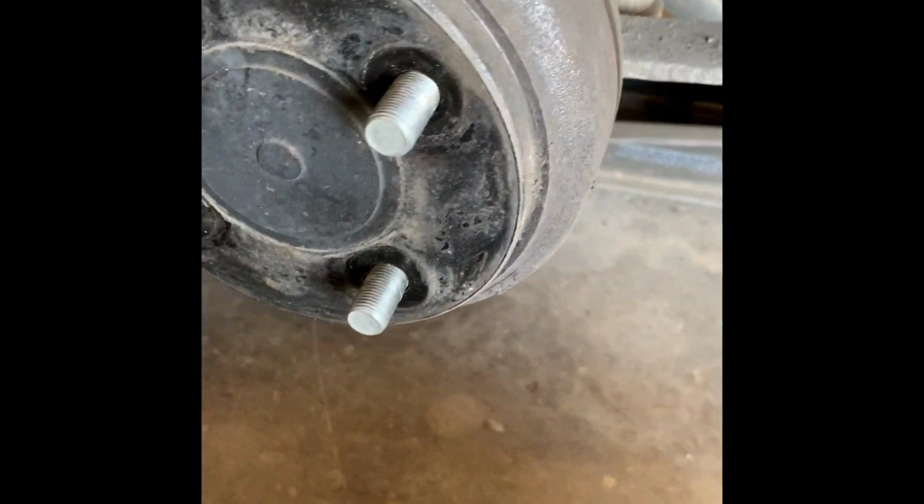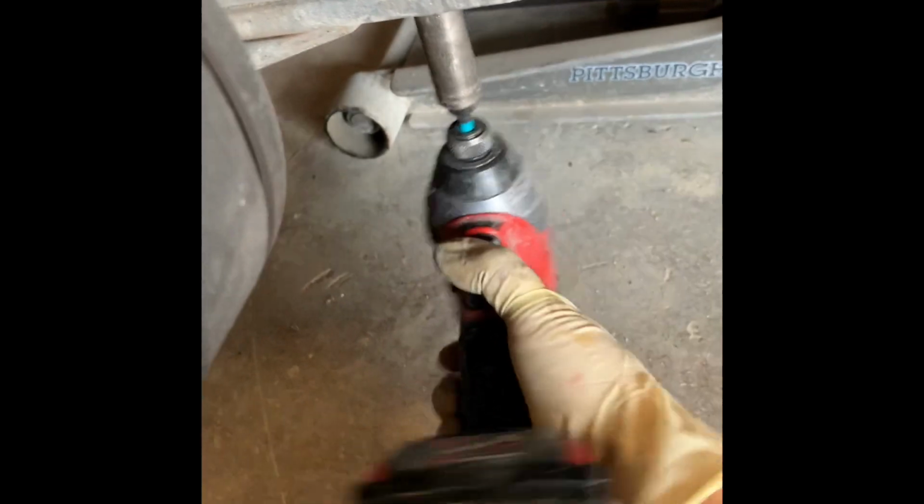So there's your U-bolt, not saving it, don't need it, it's trash. Now we're gonna get that shock off. All right, got that. Now we're just gonna lift it up. The other end stuck to there. So we're gonna save these because we're gonna need these whenever we get the actual drop below the leaf.